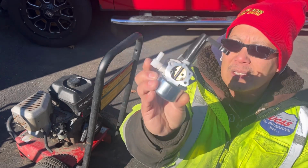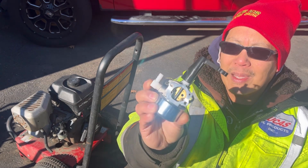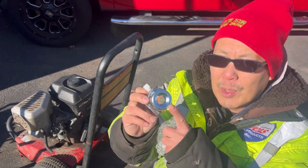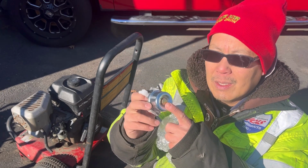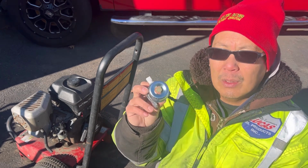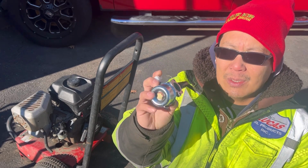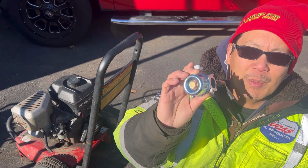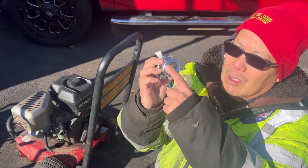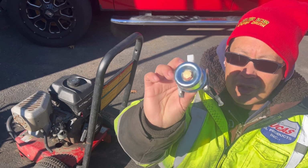As you can see, this is the one with the plastic upward pointing nozzle where the gas goes right into. And as you can see, this carburetor bowl is unique, it has an inset or recessed jet nut for the bowl. Only Briggs & Stratton has that. And this is similar to the Quantum engines and also the derivatives of the Quantum engines, such as primer bulb type, auto choke type. It all has the recessed jet bowl nut on the bottom. When you see that, you know it's a Briggs & Stratton.